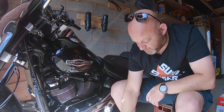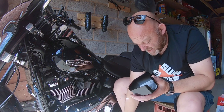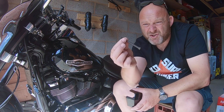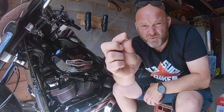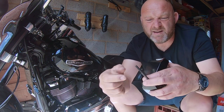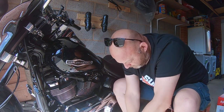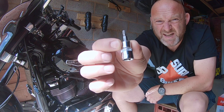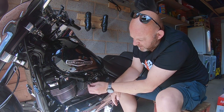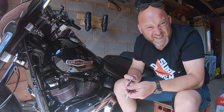A couple of tools is all you'll need. This one comes with a little installation kit. Basically, it's just a longer bolt with a little spacer. That's all you need — a little spacer and a longer bolt. That all goes through there. First thing you need to do is get one of these — it's a Torx T27, and that will undo that bolt in there. So that's what you need to do. Let's do that.